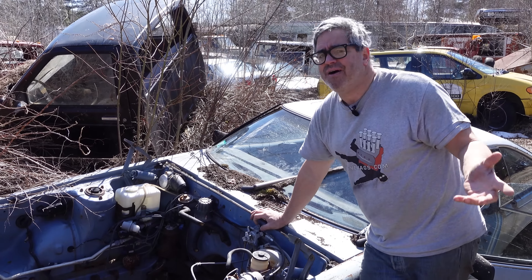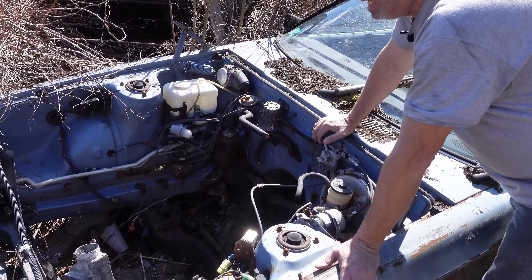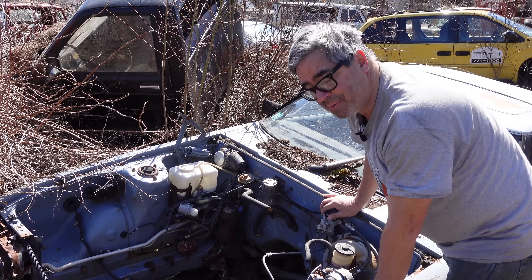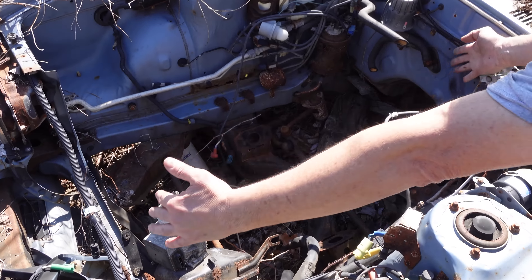Why add 5 inches? Well, right up here would have been Toyota's inline 6-cylinder engine, specific to the Supra only, to give it some super performance to take on the 6-cylinder Datsun Z car. When the engine bay is too small to accommodate a 6-cylinder, you make it longer. The frame rails and inner fenders on the Supra are very specific — longer up here by 5 inches to accept the 6-cylinder engine.